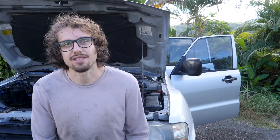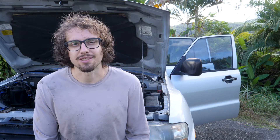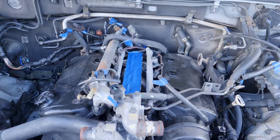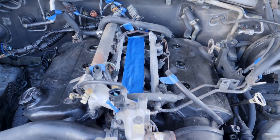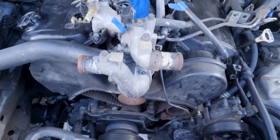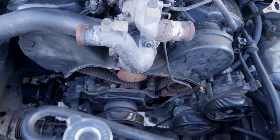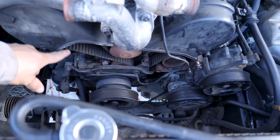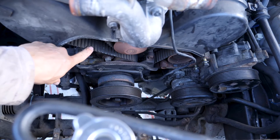This is part three. It's day four of the repair and what I have planned for today is to get the timing belt covers taken off, position cylinder one at top dead center on the compression stroke, and hopefully remove the timing belt. This is the state of the engine on day four. This is what I'm hoping to get to today — this cover and also this lower cover. And then this belt in here is the timing belt.